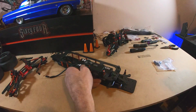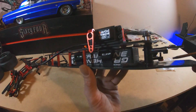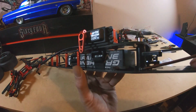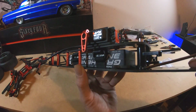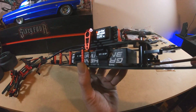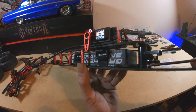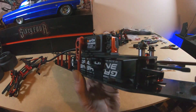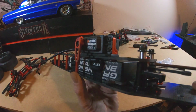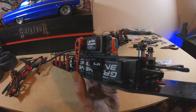So you notice on the bottom here, I have the fat one, which is touching the chassis plate directly. Then I have the thick washers, and between the thick washer and the actual bearing, I have the skinny washer to hold on to just the one race. And I have the same thing done on the top. Only thing is that I don't have as many spacers over there. I just have the one small spacer, the one big spacer, and that's all she needs.